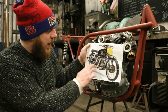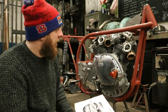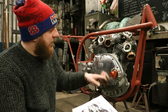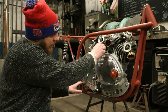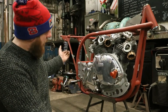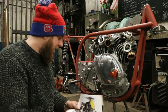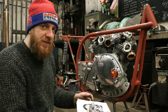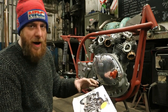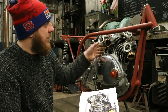It's running at the top end which is why you put big bore pipes on it. This one is changing it a little bit - he's going to run this on road as a café racer. He turned up with a load of different dimensions. If you do them in inch and five-eighths, which would be the standard size, you'd normally run them down into a two-into-one. But this guy wants some sawn-off shotgun style, full bore all noise out of there, maybe with some baffles. The fatter they get, the shorter they get - and with full bore pipes it's just not going to run nicely around town. Smaller pipes give you a bit more bottom end.